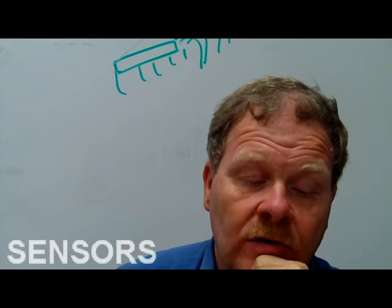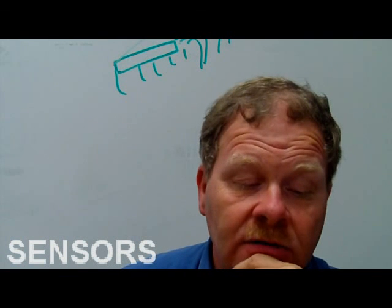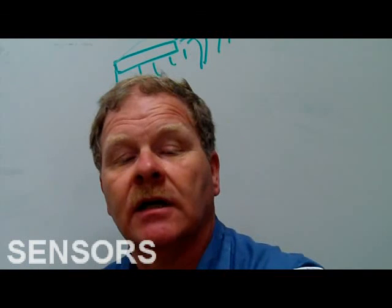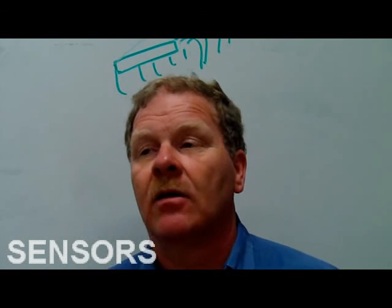The diagnostic trouble code group designated by alpha code U0, U1, U2, and U3 is network code. That's what we're getting on there. Doggone Cobalt. And we got the transmission computer's bad on it. It's got power and it's got ground. It's got everything it needs, but it ain't talking and it ain't shifting. And we ain't got no speedometer operation.